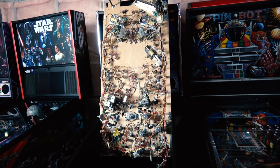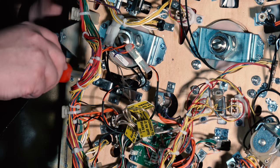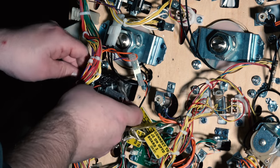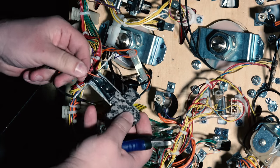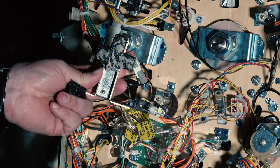You can see here I've got this section zoomed in on the camera and we're going to remove that from the bottom. There are just three screws — I think it was a quarter-inch nut driver I used to remove this — and it just pulls out from the bottom. You will have to remove the light; I think there's a flasher inside of it. We'll pull that out, stick it to the side, and then take this back to our work table.